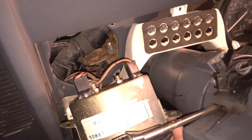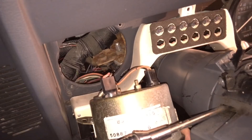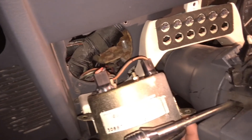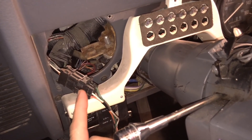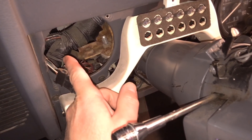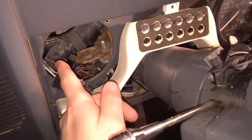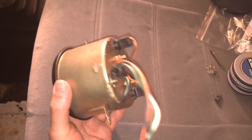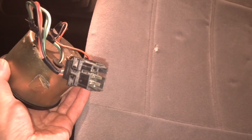With the screws disconnected, there's actually quite good room to get the whole gauge out. It comes out like this, and these sockets are where you put your new LED lights. Behind there you can see the green, yellow, and red wires going down the hole — that one has a fast disconnect which I'm going to remove now. The disconnect can be difficult to reach since the cord runs quite deep behind the main harness, but you reach in and wiggle it out.